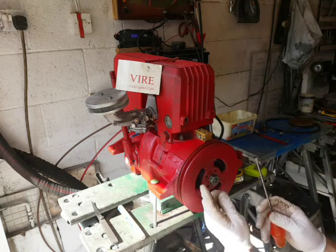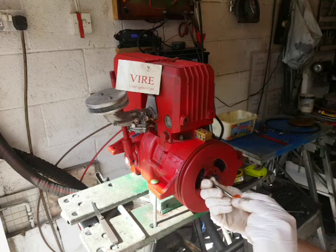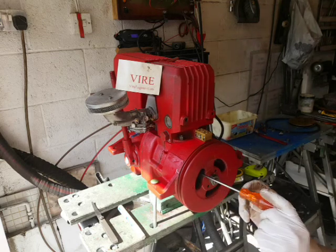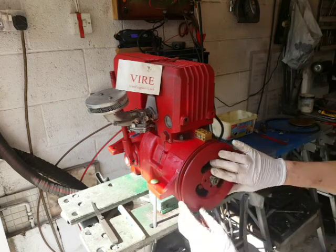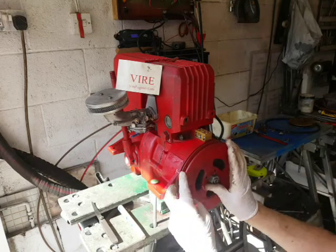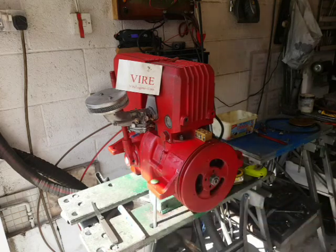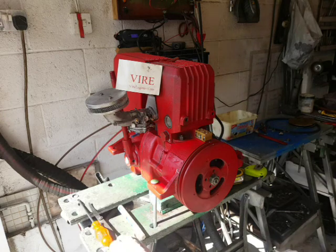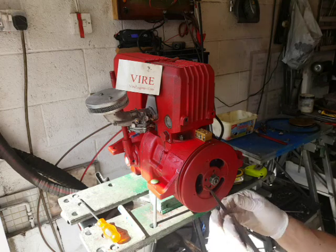At the moment the points are out because I've just replaced them. I'm now going to adjust them — free off the tightening bolt. There are a couple of slots for the screwdriver. I can get a gap roughly 17 thou by eye. Now I'm going to rotate the flywheel round until I can see it's open but not moving, and in this area the mark turns out to be exactly vertical — the ideal position for setting. I'll clean any dirt off the feeler gauges.